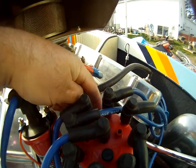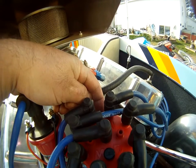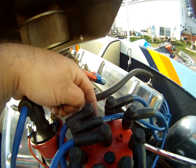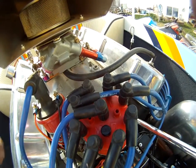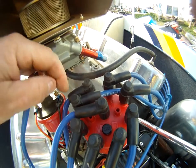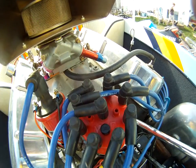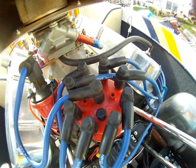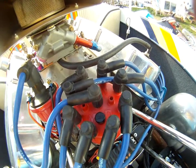What I was saying is the rotor is always going to point at this position here at the light. So when your timing comes on, it should be sparking around here. If it comes in a little earlier, it'd be around here. But your phasing is way over here now. You can use my method — the number one is over here now, not over here, so I would adjust it to point over here. But I believe the best method is the way they say — drill a hole in it and look at it with a timing light to see where it's really pointing. You can see that you would turn your rotor slightly in this direction to get it closer to the cap.